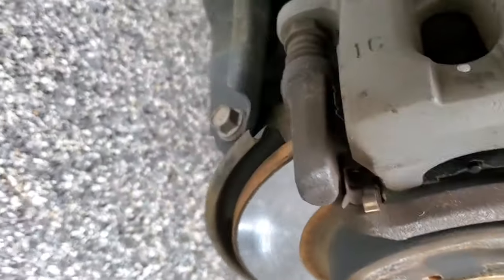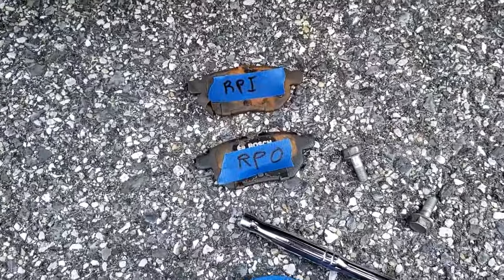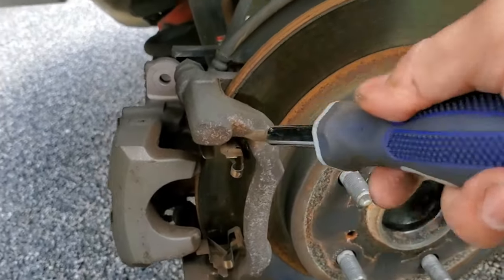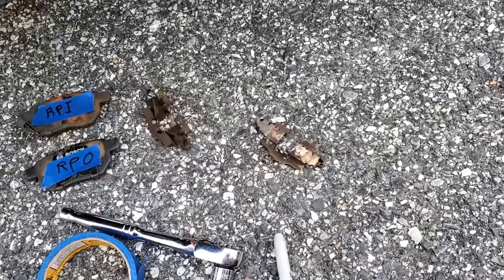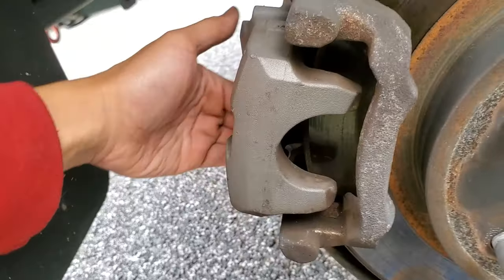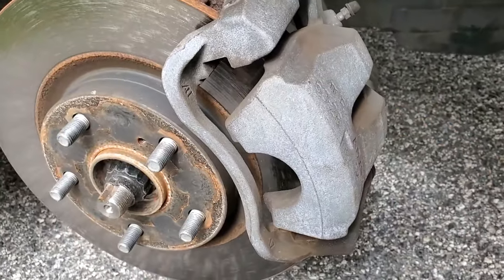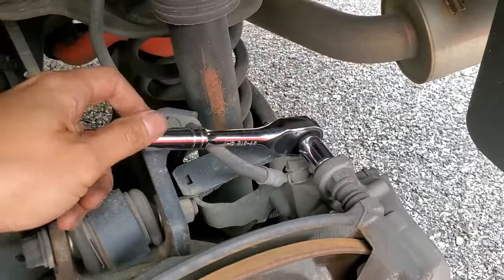Make sure the e-brake is off before you do the rear calipers, then it's the same process: remove the two 14-millimeter bolts. The rear caliper will have more restricted movement than the front ones, and you'll have to remove both the inside and outside pads and label them appropriately. Take your flat head screwdriver and pop out the front part of the clip, then come around on the back side and push it down to get the back side out. Replace just the top bolt so you can swivel the caliper up and out of the way while painting — it makes it easier to reach the hard spots. If the caliper guide pin rotates, hold it in place with a 17-millimeter box wrench.